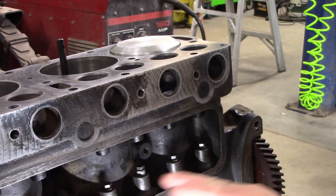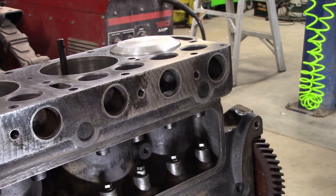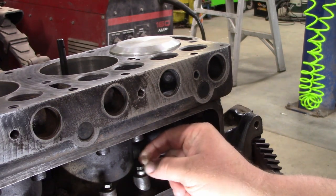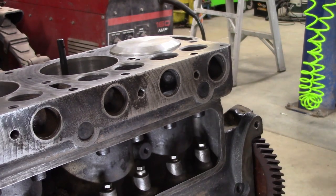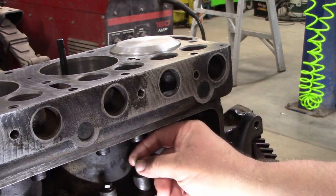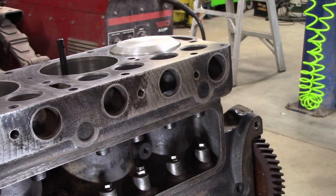What we're doing today is temporarily putting some things together to do some fitting. We also went with the adjustable lifters, the two-wrench kind — seemed to be the only thing available right now. What we did was temporarily flip the block upside down and put all the lifters in. That way gravity helps hold them in.